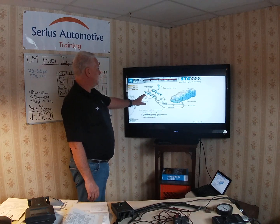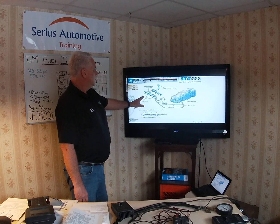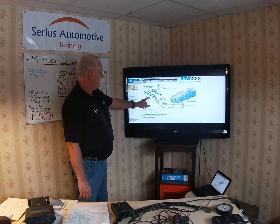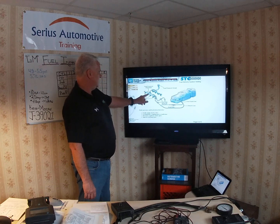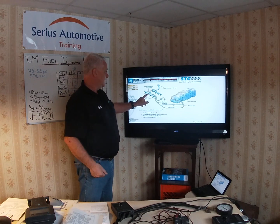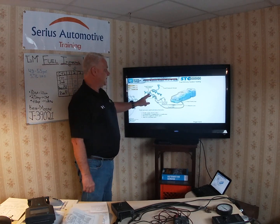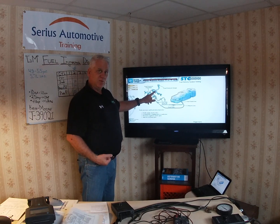Let's look at our computer-based training — here's a breakdown of the fuel rails. On this one, the regulator is right there on the back, the return side of the fuel rail. The regulator is always on the return side unless it's in the tank. On my particular vehicle it's on the return side of the fuel rail.